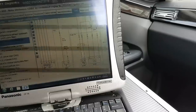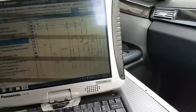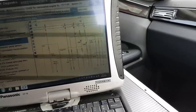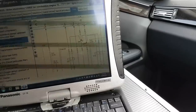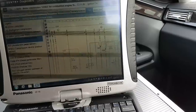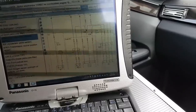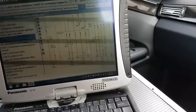Found B28 - this is my sensor here. Sensor pin 1 goes straight to pin 53 on the ECU, which is the signal in. That's my voltage out. The middle pin is my ground, which is shared with other components. So I need to make sure I have ground and voltage at my sensor. If I do, then I start to blame the sensor.